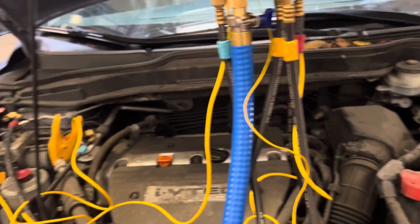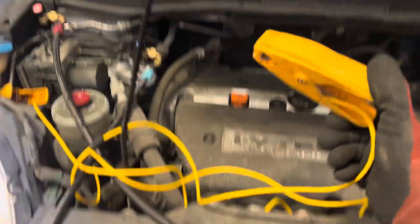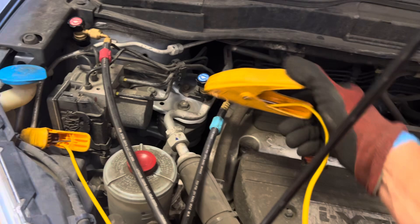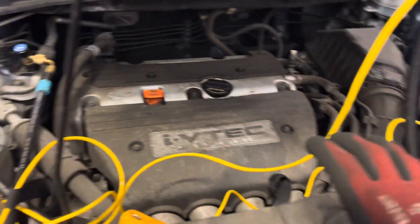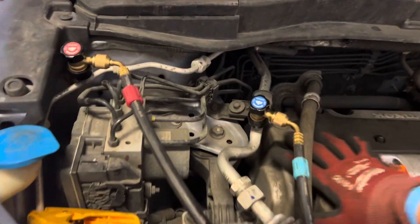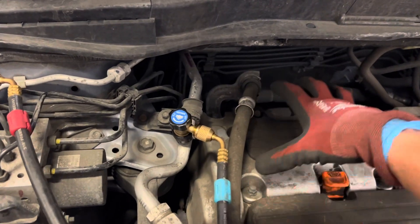What is happening here? Placement of your clamp to take superheat is really, really important. What we're doing is picking up heat because this metal pipe is exposed to underhood heat. We've got hot coolant, air blowing this way, and a hot radiating engine.